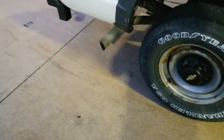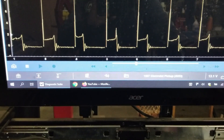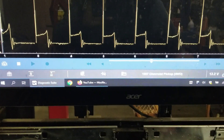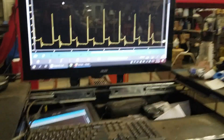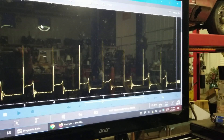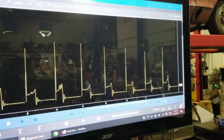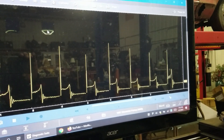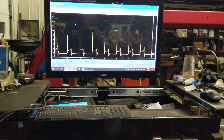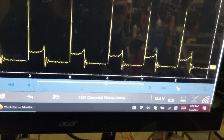You can kind of see it wobbling. You can hear it out the exhaust and you can smell it. There's definitely a dead cylinder, so I'm going to get the oscilloscope on it and find out which cylinder is misfiring. Here's the engine idling — I can see cylinder two's jumping around pretty crazy. Five — actually not too many of the cylinders look real good at all. When I snap the throttle, two's going crazy. I feel like I have a problem with cylinder two.